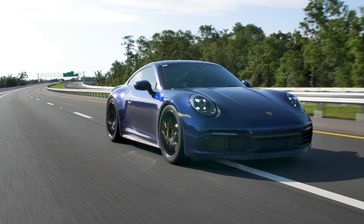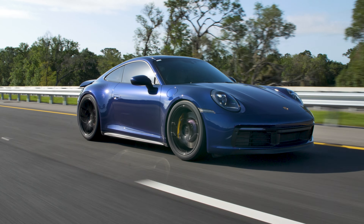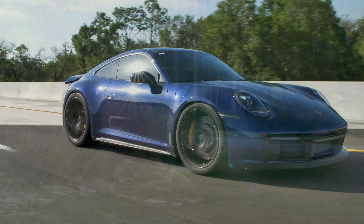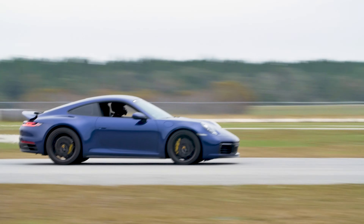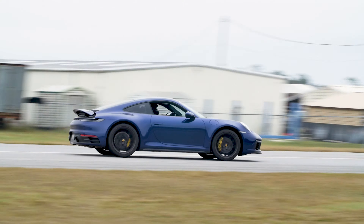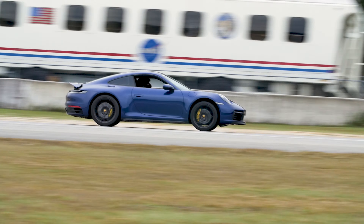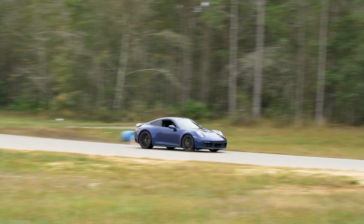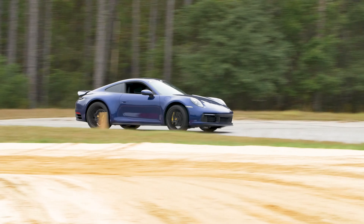At speed you're getting a little more airflow, which actually helps the stock intercooler quite a bit. Either way, you're getting good results in both tests — anywhere from 10 to 15% lower IATs. These tests represent what's most common for a street client doing occasional pulls or stoplight-to-stoplight racing. But really where this product makes the most sense is for someone tracking the car on a road course, where you're constantly under load, under throttle, under boost. Those turbos generate heat, and this intercooler more efficiently dissipates that heat, keeping your IATs lower.